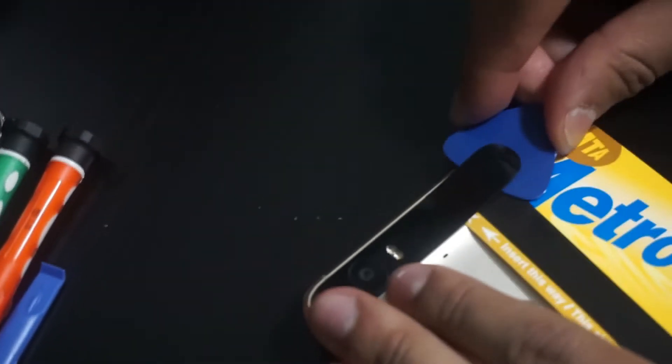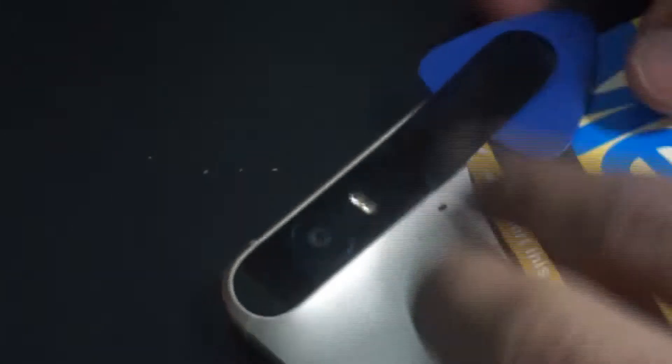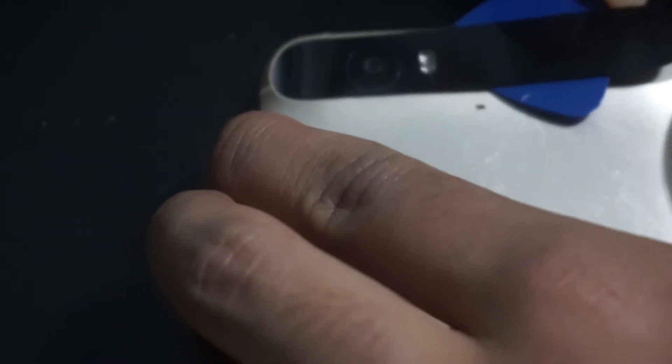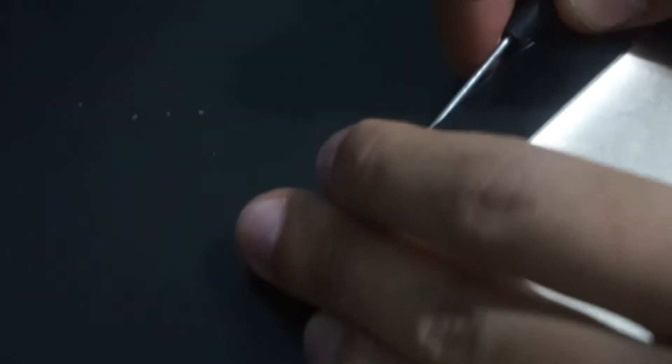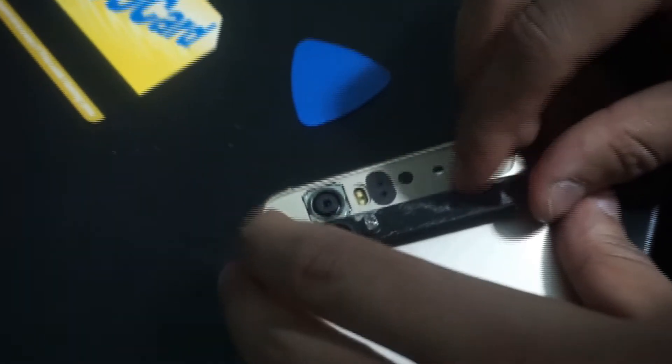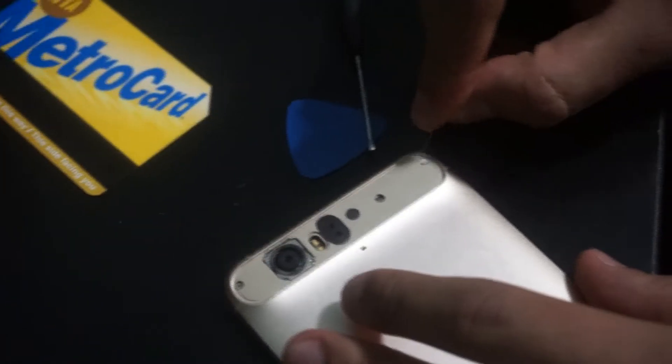Bring in the triangle picks. I feel like this might crack here, so I'll just take this side out and slowly push through. Many YouTubers have a hard time with this — it just cracks. But as you can see, we're slowly able to cut through. Now we just go around on the top. There is a flash assembly, a plastic assembly that's connected, so let's go over to the other side. A couple of times this will lift up, so we'll have to do this again. Once you do that, you should be able to glide with the screwdriver carefully. Make sure not to damage the camera lens, because if you damage that it's going to be quite difficult to get one of those parts. As you can see, we got it off successfully. Take that off, put it aside, and we move on to the next step, which is to remove the tamper screw. Push this up, get the white sticker out of the way.